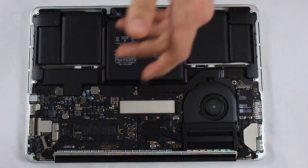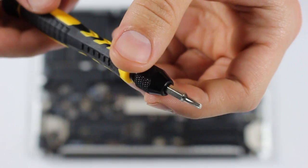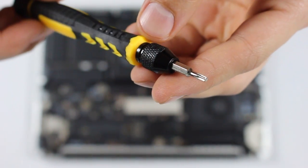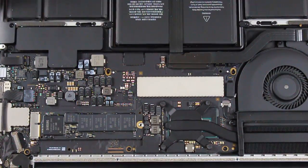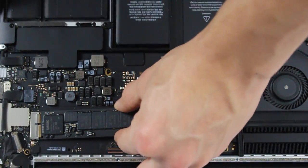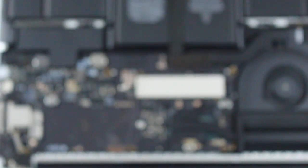Once you have them all off, go ahead and crack open the back. Sometimes it does get a little stuck so don't be afraid to give it a gentle pull, just not too hard. Inside, all we need to do is remove one screw with the 6-point screwdriver — this came with a kit that I'll link in the description, great for phone repairs and only around $16. Go ahead and start unscrewing that single screw. It's not magnetic so make sure you keep an eye on it. Once you have that off, gently pull away at the SSD — make sure not to pull up or get those prongs stuck in the slot, otherwise you're going to run into some issues.